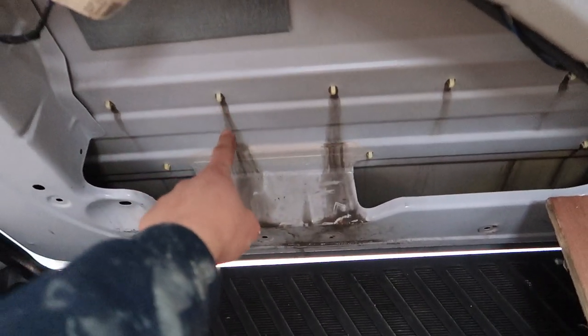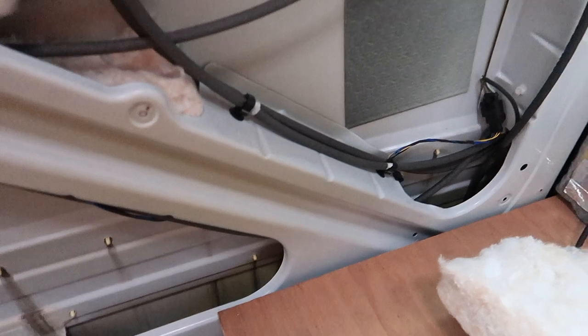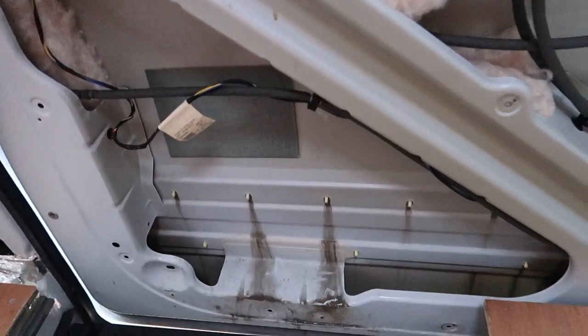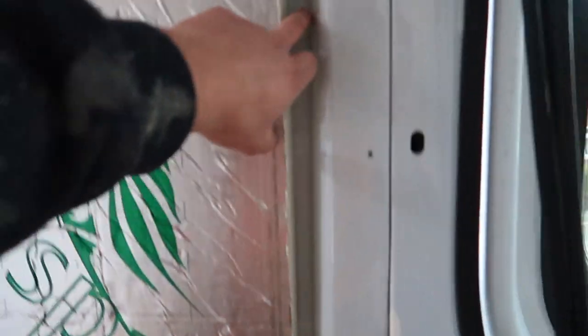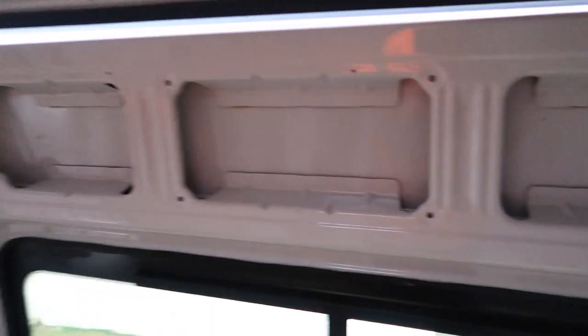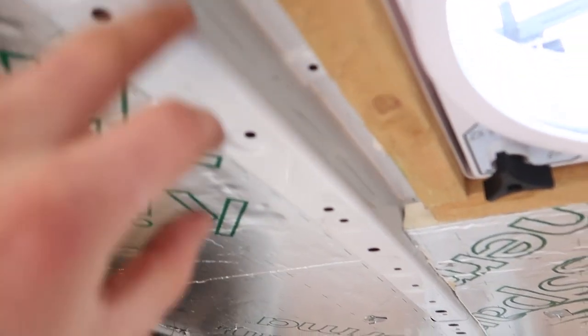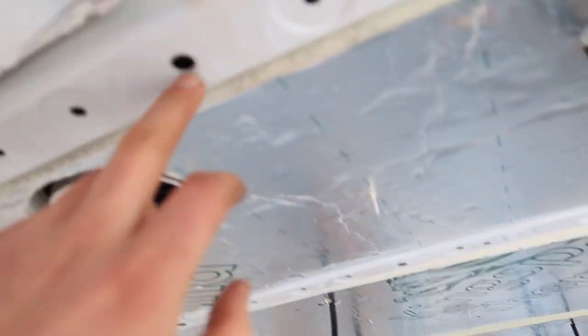You can see the strip holes down the back of the plastic bumpers on the outside - I forgot to do these and I'm going to do them now with Sikaflex. That's going to be filled with recycled bottle insulation. I've also got some expanding foam here - that's the gun and the expanding foam - so all of these little gaps in here, up here, and around the corners are all going to be expanding foamed. Above the door there is also going to be filled with bottle insulation. Any gaps I'll probably fill with a bit of Kingspan before expanding foam, and I'm going to be expanding foaming in these joists as well.